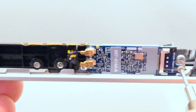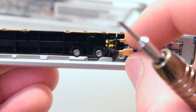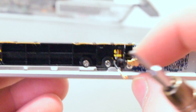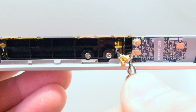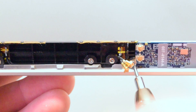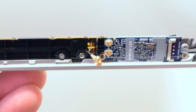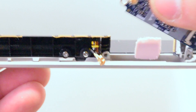There are two Phillips head screws that are holding down the Wi-Fi card. Unscrew the right screw, then gently disconnect the antenna cables, and now you can unscrew the left side screw. The airport card is now free and you can gently remove it.